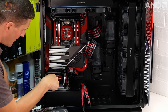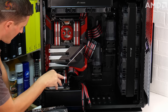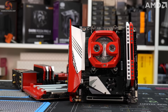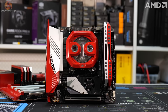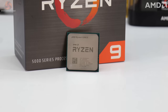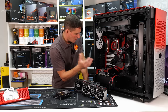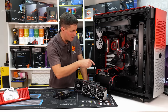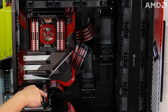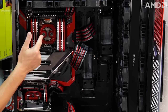The second system, you can see installed on top of this power supply shroud, is a mini ITX system, X570 Aorus Pro Wi-Fi motherboard, again PCIe Gen 4, an AMD Ryzen 9 5900X CPU, 12 cores, 24 threads, probably overkill for gaming, but we like overkill, especially in this system. 32 gig of RAM in the gaming system and 64 gig in the top high-end desktop system.